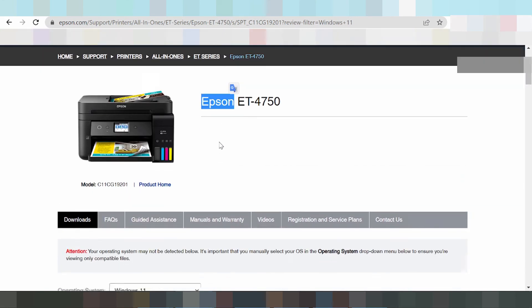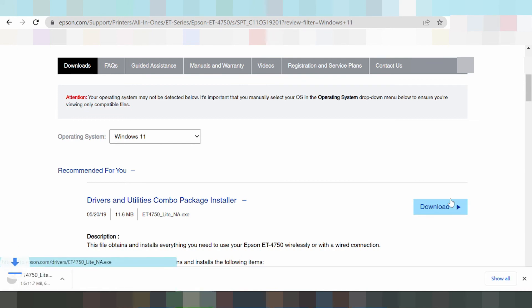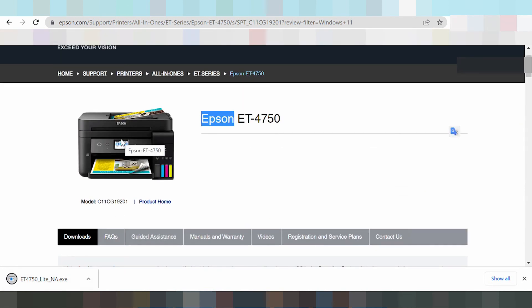In this video I will show the Windows package installation. If you need to install the driver for the printer via USB, turn on the printer, plug in the USB cable to your laptop or PC, and the laptop or PC will detect the USB printer automatically. If you need to install the driver for Wi-Fi, connect the printer to the Wi-Fi, scan for the printer's IP address, click the IP, and installation completes automatically.